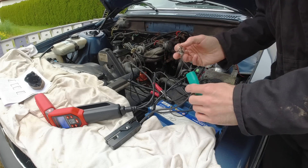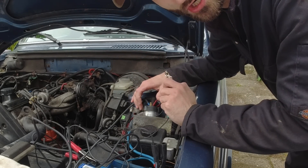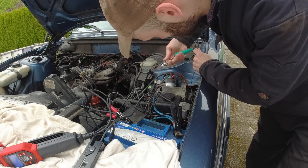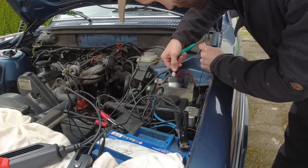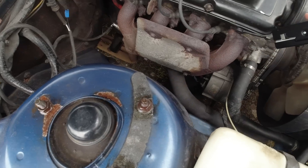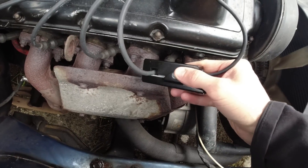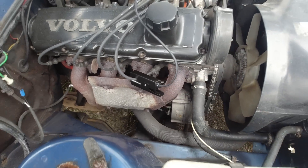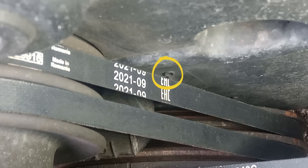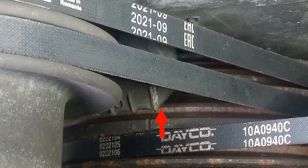This one goes on to the minus connection on the ignition coil if yours has it. And thank you again Hawker - if that's how you say your name - for the timing light. That goes on there, we've got a free terminal for that which is quite nice. And then lastly this one has to go to the number one cylinder - that's zero top dead center, so this mark here is 10 degrees before top dead center.